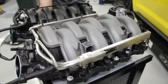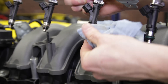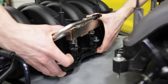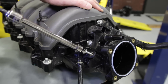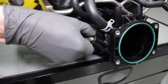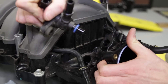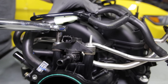On the factory manifold, pull up on the fuel rails to remove the injectors and take this time to clean the tips of the injectors. Remove the two vacuum lines on the IMRC solenoids and rotate them out of the way. Position the fuel rail and injectors into place and press down firmly to seat them into the new manifold. Reposition the vacuum line and reinstall the two hoses back onto the IMRC solenoids. On the factory manifold, remove the passenger side PCV inlet by removing the 8mm retaining bolt. Clean the inlet if necessary, position it into the GT350 manifold, and use the provided hardware since this is now fine thread instead of coarse thread — torque the bolt to 89 inch-pounds. Repeat these steps for the EVAP solenoid: remove the two retaining bolts, clean the solenoid, position it into the GT350 manifold, use the provided hardware, and torque to 89 inch-pounds.